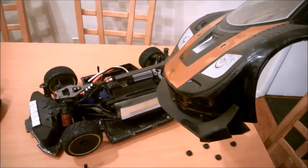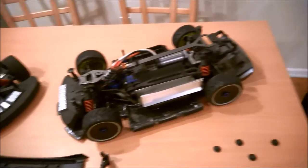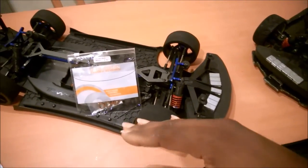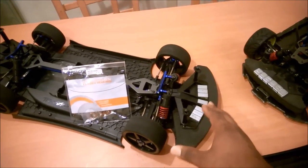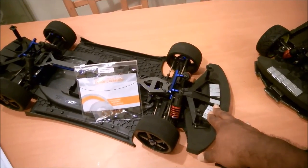built onto their car. That guy is made to push down to give you downforce. So I'll argue that if you have the car set up properly, with the weight in the right place and a little bit of a downward cant so you're not getting under the car, you're generating good downforce, then you may not need quite that much weight.